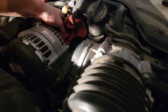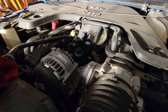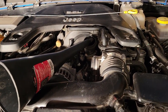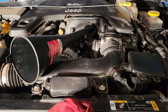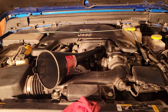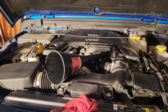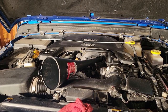Nice and tight — I'll get the light in there to make sure it looks good, then the filter should be done. We got the drain plug back in, the filter is good to go. Now the last thing is to fill this up with some fresh oil. It doesn't need a full five quarts but it does need a little over four, so we're gonna do four quarts, check it, pour a little bit, check it — like we did last time.